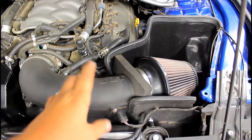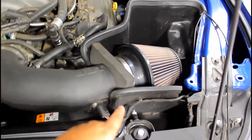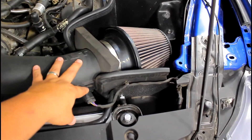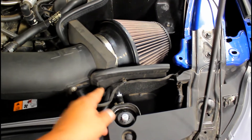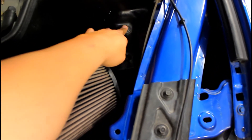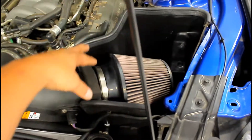For the front sway bar we need to move the air box out of the way. If you have a factory one it's gonna be a little different, but more or less you need to undo your hose, mass air flow sensor plug, and harness, and remove the bolt in the corner by the fender, and then all this should be able to come out.